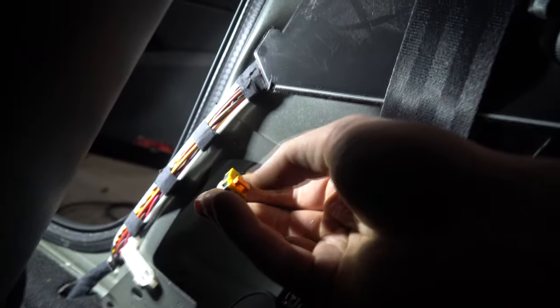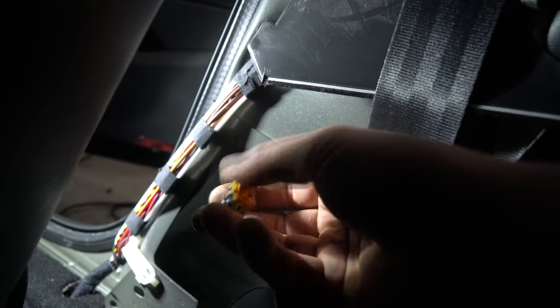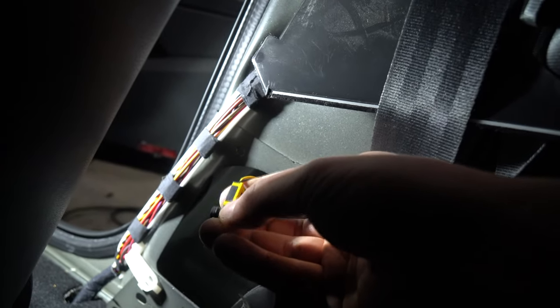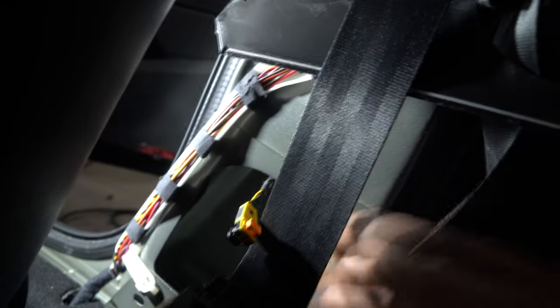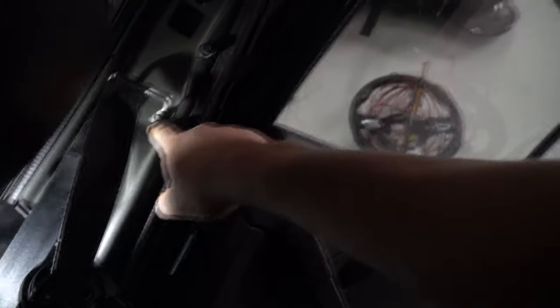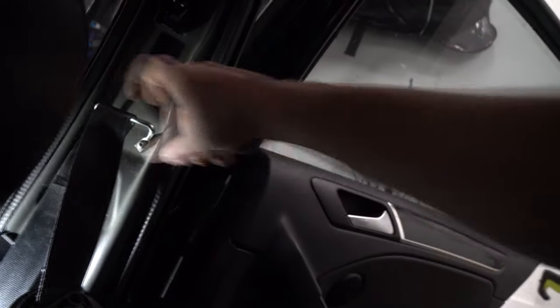After you pop that orange tab up with the hook pick, you'll see these little black duct tabs on the side. You'll have to squeeze them on both sides and then it'll just slip right out of the passenger side. That sounds beautiful. Now that we know this seat belt is done, grab our Torx and loosen. We might even be able to just get away with loosening one side off — we'll slip it right off and then we'll slip the new one on.